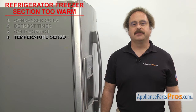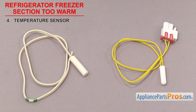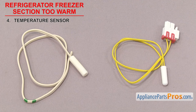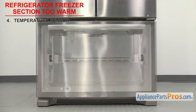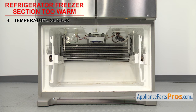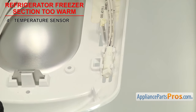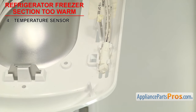Now we need to check the temperature sensor — it tells the control board the temperature inside the freezer. Temperature sensors are white plastic sensor bulbs that tell the control board the temperature inside the freezer section so it can run the compressor as needed to maintain the desired temperature. Temperature sensors are often used in multiple places in the fridge — many times behind the back wall, inside an air duct, or behind an access panel. If the freezer section is too warm, it could be that the temperature sensor has failed or is reading out of its normal range and the control board thinks it's colder than it really is.